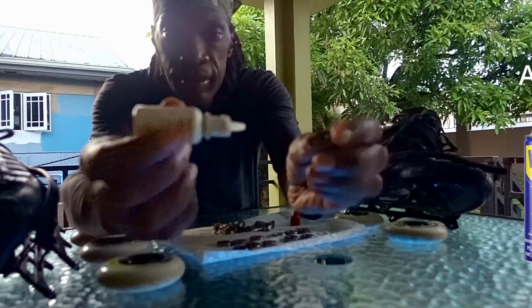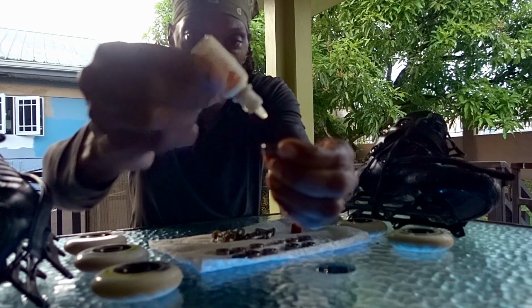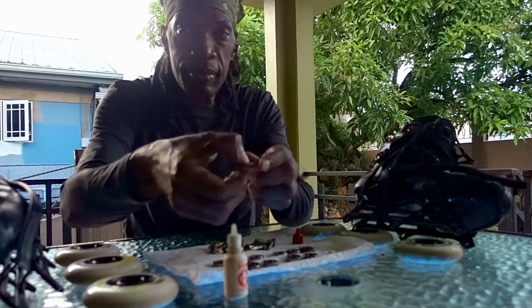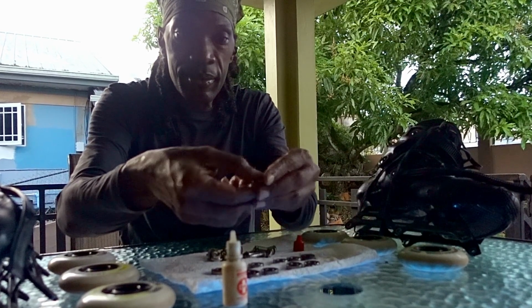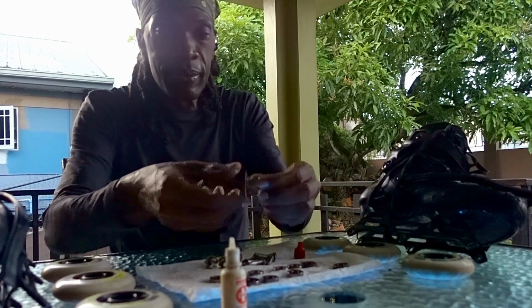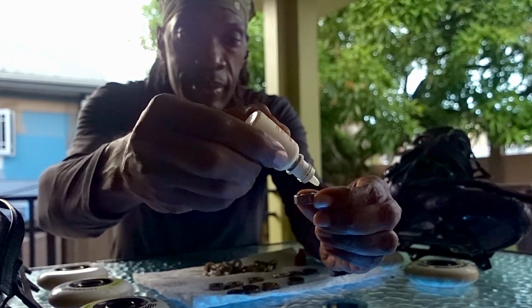It has a poor viscosity and does not include the additives in oil-based lubricants that protect rotating parts from friction and rust. It is of course much better than nothing at all. I used it several times and it makes your bearings spin really fast and smooth initially, but then it dries out quickly, leaving the bearings dry and noisy after a few sessions. Now look at this.